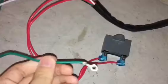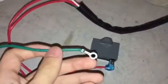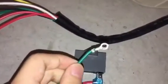Here's the actual wires that come out of the fan. The red is just a capacitor, so this is kind of hooked up already. The green is the ground — I know for a fact because of this connector, and green is always ground. You don't need this wire for the fan to run, just for added safety. So this is what we're working with: the white, the yellow, and the black. This is a two-speed fan, so I'm assuming maybe these two are for speed control, but I'm not exactly sure.